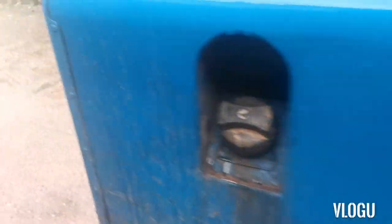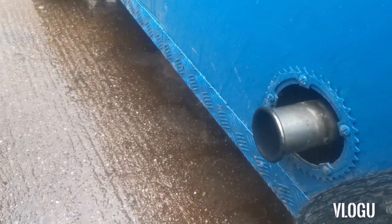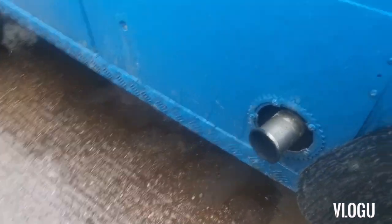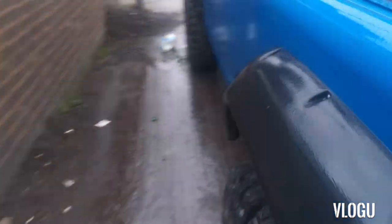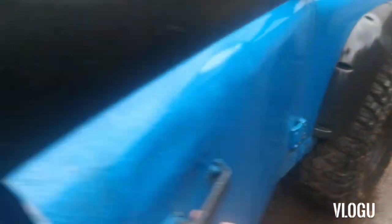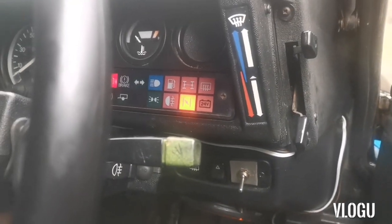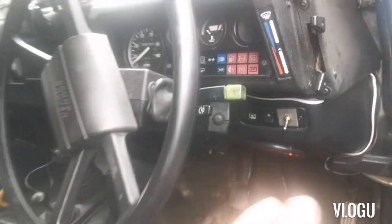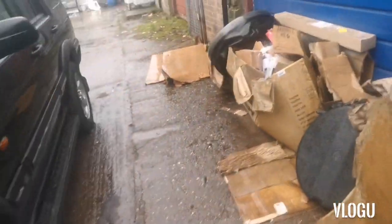It's running well. You can already smell the vegetable oil straight away — smells a bit like cooking coming out of the exhaust. I always find that it's got a bit more power and it runs smoother with vegetable oil than it does with diesel. If you're planning on running it on a 200TDI or 300TDI you shouldn't have any issues. On your TD5s, like I say, use a 50-50 mix and you shouldn't have any issues with that either.